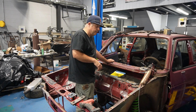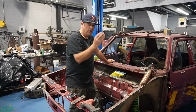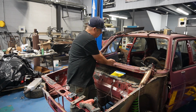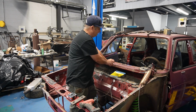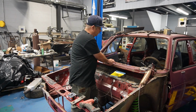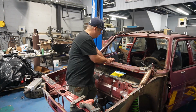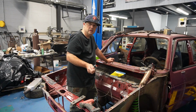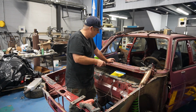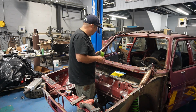That's the center line. On the older versions, like the Mark II single wiper that Bonrath used to do, they used to have an offset wiper that would bolt on the side. Problem is that I'm not gonna make a wiper that's offset 2 3/4 inches. That would just look dumb. So the next thing is I'm gonna cut this out, sand it, get all the rust off of it, and then transfer the size onto this version, cut this out and swap pieces. So let's see what we get.